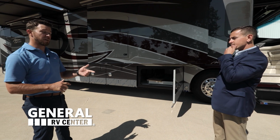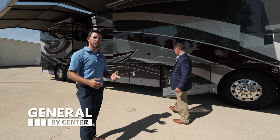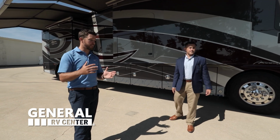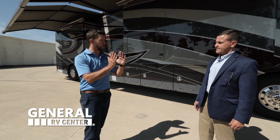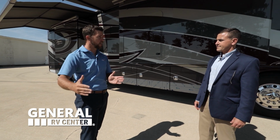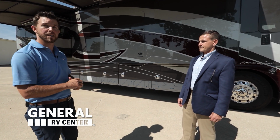And another benefit of that V-Ride while you're on that, Tom, is when you're going through the mountains and you're taking them curves, you can do them with confidence and speed. Typically, if you don't have that, you're going to get your unit to twist a little bit, and it's going to want to drift outside your lane. So with the V-Ride paired with the Liberty Bridge, it essentially eliminates all of that.